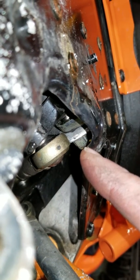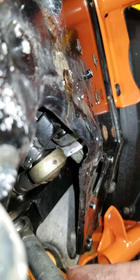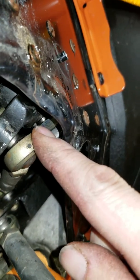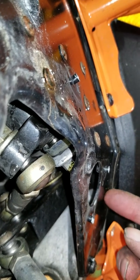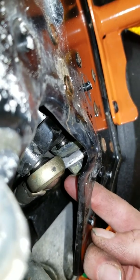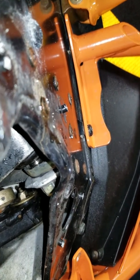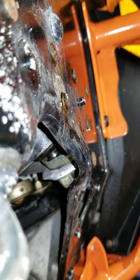What I did is I took an Allen wrench that just barely fit around the back side of that post and dropped it in, getting it wedged in there enough. With my impact driver on the nut through this hole, I held that Allen wrench in there — it did get it in a bind, but just a nice little cheater. It's just a round shaft with a 14 millimeter nut on the bottom.